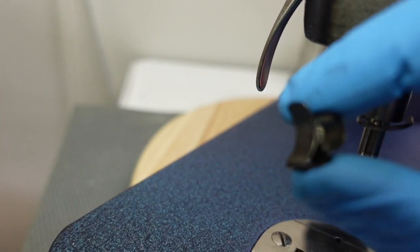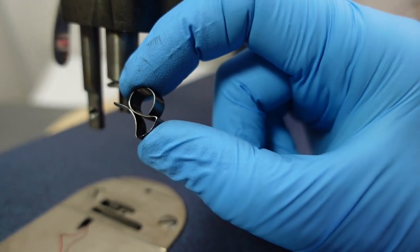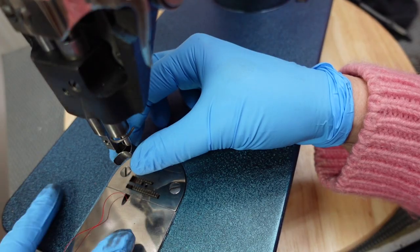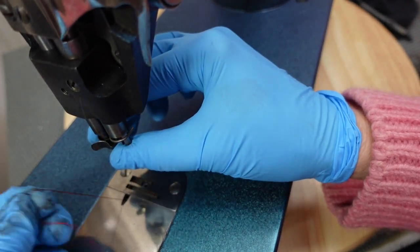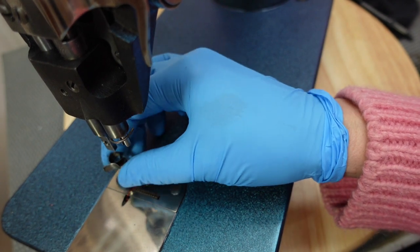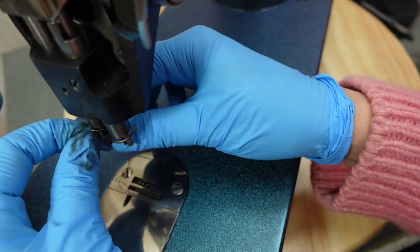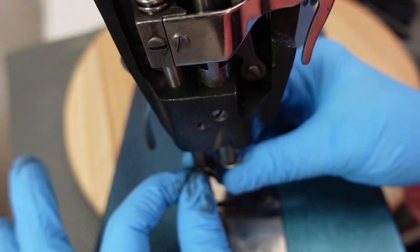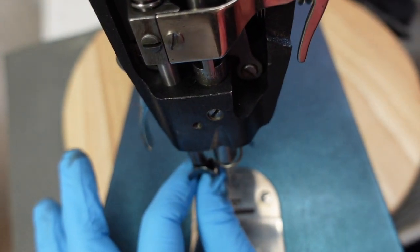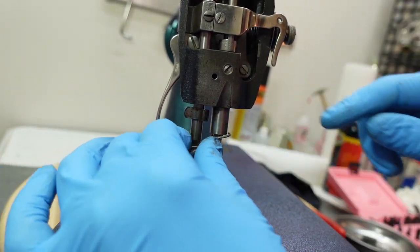So if you didn't know, these little thingies here are thread cutters. It's just a little spring, extremely sharp on the top because that's the blade. Say you want to cut a thread — what I do is pull it from the back to the front through there and it pops down. To me it makes sense to set it on this way. You have to put it on before you put your presser foot on. It's just spring-loaded; if you need to use a little pair of pliers to wiggle it on, just wiggle it on. So it's up here at the very top. I'm going to go ahead and set this length here. I need to loosen up this screw so my presser bar can go up and down.